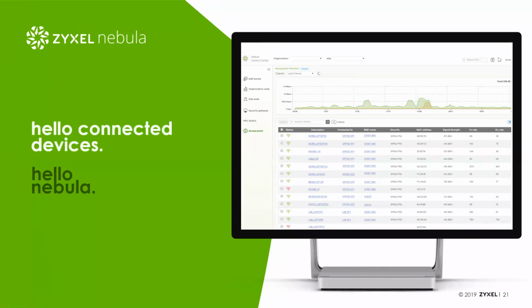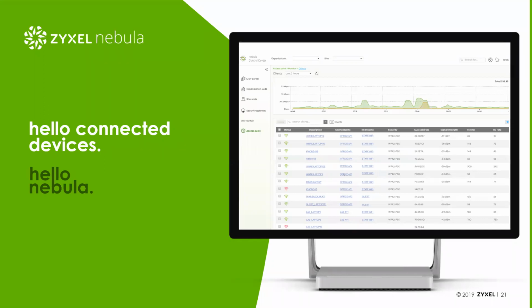And we've got a number of other screens here that you can see as you drill in. This is showing us the connected devices on Wi-Fi, who's connected, and you can customize which columns you have there, so you can see which SSID they're connected to, which specific AP they're connected to, signal strength, MAC, client type, all sorts of other stuff, as well as visual graphs showing you utilization of different periods of time.